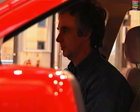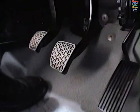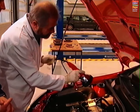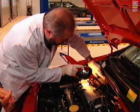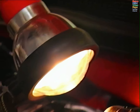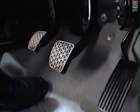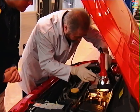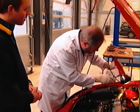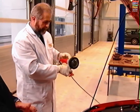So in fact, you're checking every part of the braking system that you can see from under the bonnet. Yes. Paul, could you make sure the parking brake's on, it's in gear, and start the engine please? Now I'm checking all the joints of the pipe. I can also check and listen for any servo leaks or any leaks in the servo pipe, following around and checking for any hydraulic leaks. If I had hoses, I'd check those too. Okay, release brake please, Paul. And I'll check once again — we're checking with the brake and without the brake applied. Thanks very much. Switch the engine off please. So that completes that check.